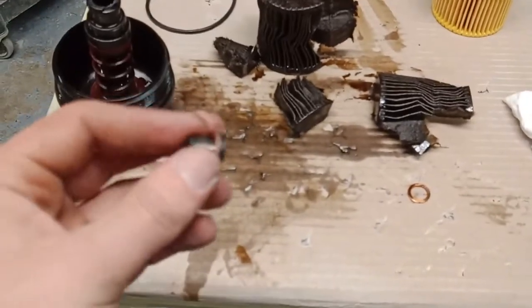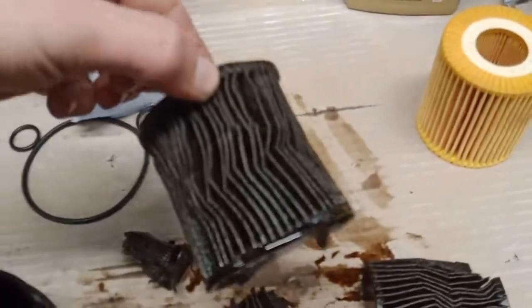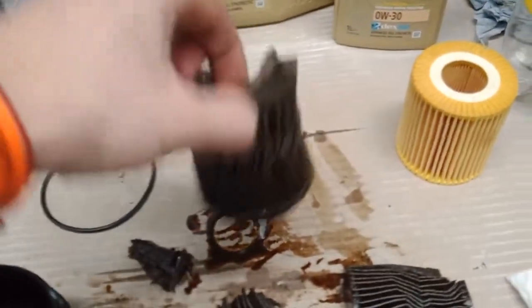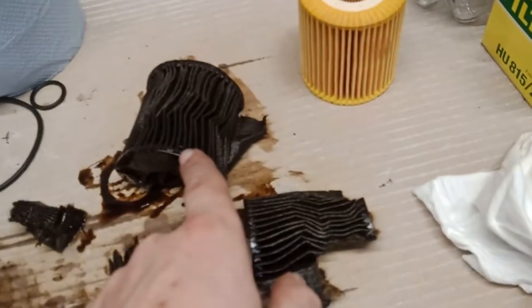Now, firstly, I wanted to put the bung, the plug for the oil sump, back in, but I messed up. Once I removed this, oil just kept on pouring out. Check this out. This is the box, just what I cleaned underneath, and look, it's still there. I hope it stopped dripping now, so I can put the plug in. And the filter was so rooted in there that, look, it's full. The fins were bent like this, by the way. I didn't bend them, they were bent like this. And it came out only in pieces. As one big unit, it didn't slide off.